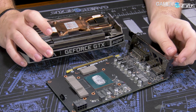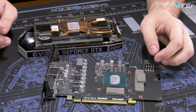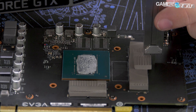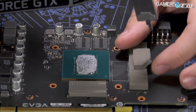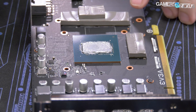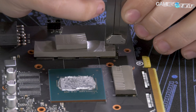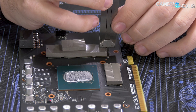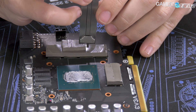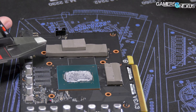EVGA has taken maybe a cooler that already existed and made it work by using an enormous thermal pad stack. This whole stack — counting the memory — is 9.5 millimeters tall. The top of the memory module is exposed, so I can rest the caliper on top of it and eliminate that from the height. That is a 4-ish, 4.3 millimeter thermal pad. That's freaking crazy. And this one is also about 4.3. That's absurd. It's better than not making the connection, but EVGA...